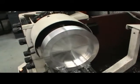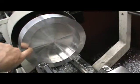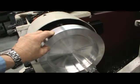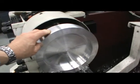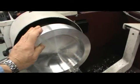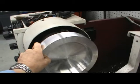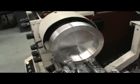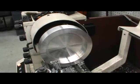This cut's about 90% done, width-wise. Depth, we're at about 1 inch. We need to go about 1.5, 1.7, somewhere in that area. The aluminum is getting pretty warm, so they're taking a break. Going to let this cool off, because the hotter this gets, the more it can warp or change while he's cutting it. He doesn't want that to happen. We'll get some shots later. He's going to put another couple hours into cutting this, and I'll get some more photos.